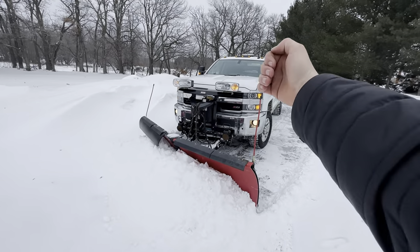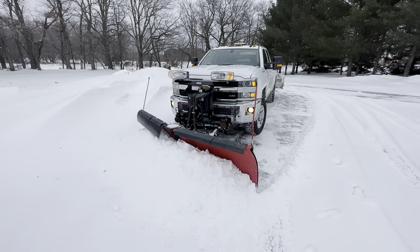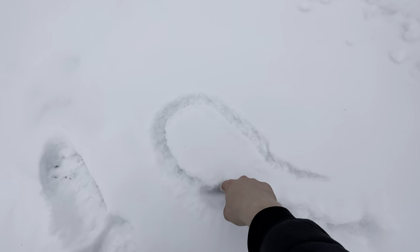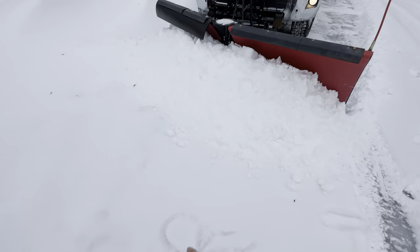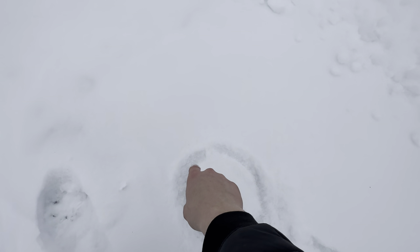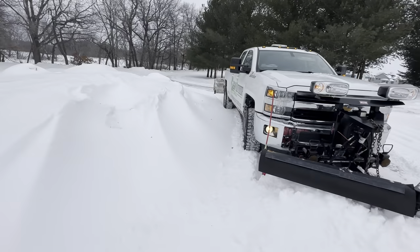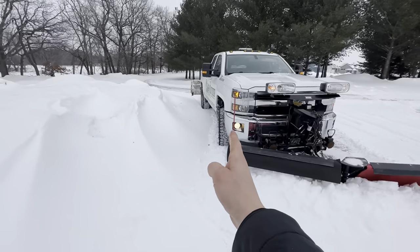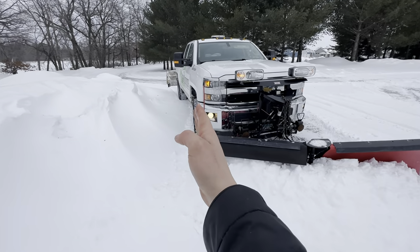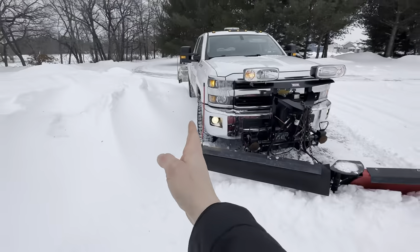When you're coming around a corner — and everywhere you go, every parking lot, there's a corner — say there's a road that comes in to the main building, loops around in a horseshoe. With this plow you basically can't plow that horseshoe. When you come in and swing, your plow is right here but your tire is driving over the curb. I'm turning here — look at my tires, they're a foot and a half to two feet over. So if my plow's on the curb, the back of the truck is hitting the curb.